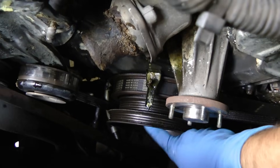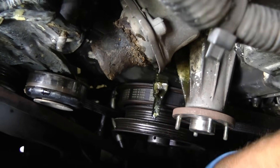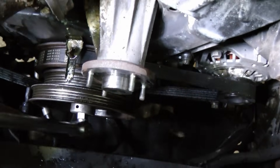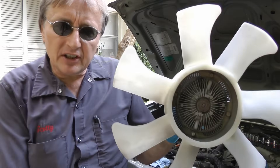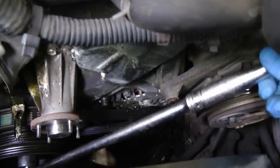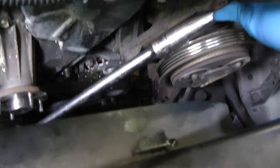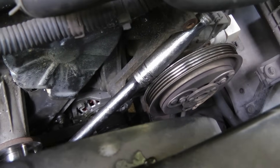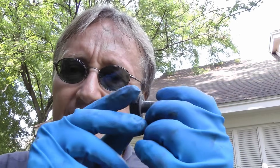And a socket. Now the crankshaft pulley is right here, so get a socket that fits on the bolt that's inside. Then stick the cheater bar on the end of the socket, snap it in, and then figure out which way the engine turns. In this case the fan turns this way, so we know the engine turns that direction. We'll turn the cheater bar in the same direction and wedge it against something solid metal, like this air conditioning bracket.